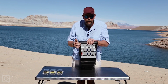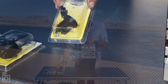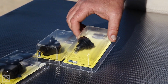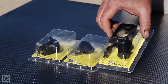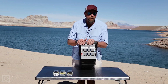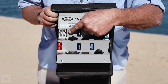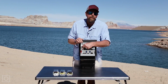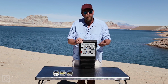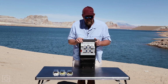All of these sockets are of the standard 29 millimeter diameter opening. Available through Equipt as well are 3 different options: 12-volt cigarette lighter, Hella plug, or USB, so that you can configure this the way that you choose to. Also available on here are 2 Anderson coupler takeoffs, good up to 50 amps. So if you want to run an inverter or a compressor or something that's going to run a lot more power, you can connect it through to this auxiliary battery box as well.